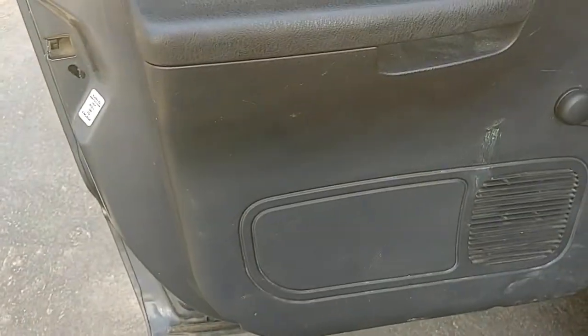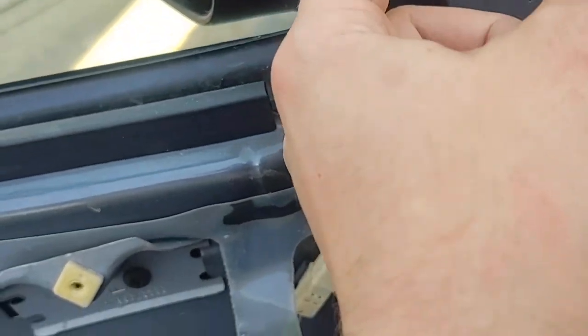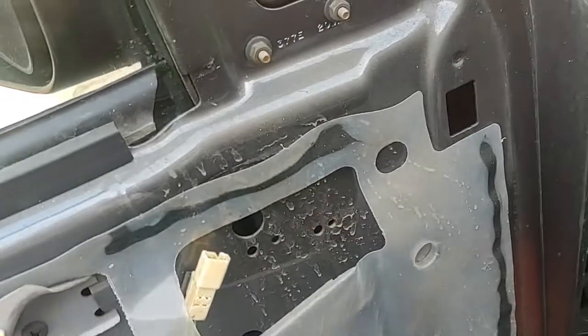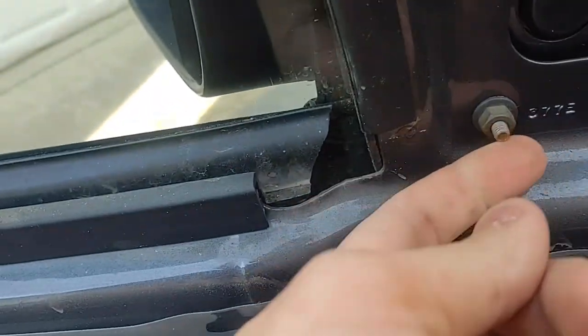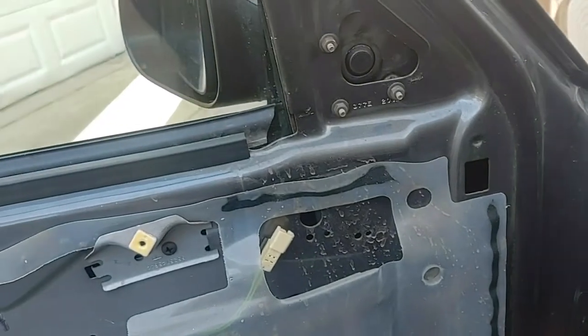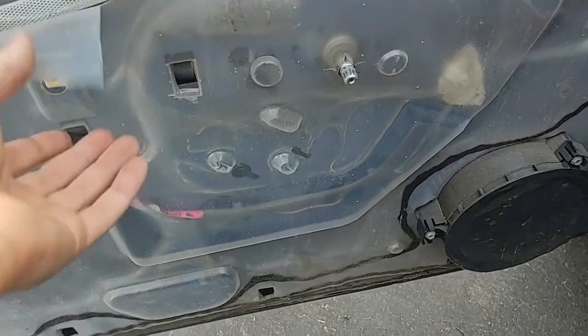Other than that, you're all set to go. There are all your screws and your door handle. These two rods are right behind the door so you're going to have to be careful when you take them out — it's going to be a complicated time. You've also got your speaker here, your window here, and various bolts you'll need to pull out. This is the component you're going to unscrew to get to the mirror and take the mirror off if it's not an automatic.